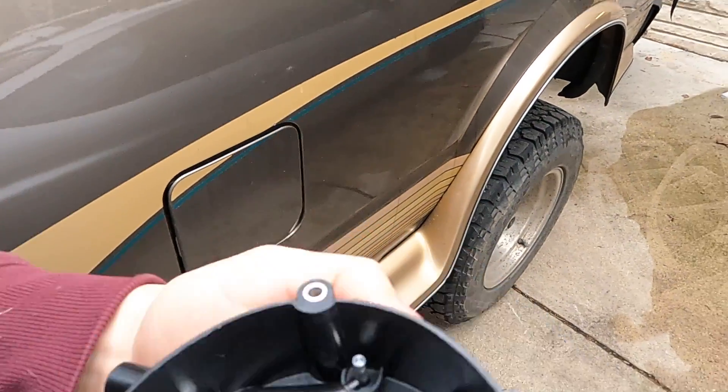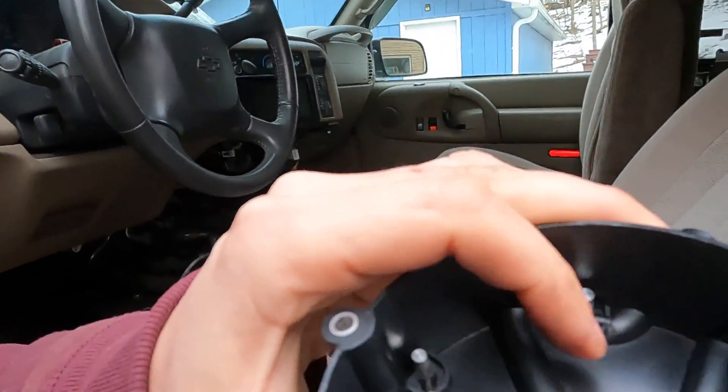You can see that little white dot on every single contact — it's always pitched to one side. Unlike the Vortec V8s, the distributor on the 4.3 V6 is not adjustable; it can only go in one way. I've watched a lot of videos on distributor rotor phasing and it seemed really complicated. All I want to do in this video is make this distributor adjustable, then drill a hole in my old cap and visually look to see what's going on in there as the engine's running. My hypothesis is that your van won't start not only because of corrosion, but because the spark needs to jump a fairly large distance instead of the shortest distance possible.